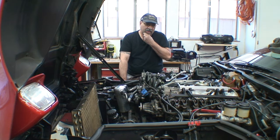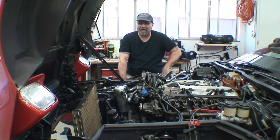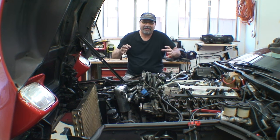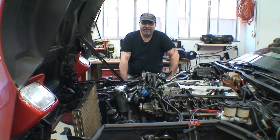All right, fine. So what I ended up doing is an old trick. I never did it, but I've heard about it, and some people were successful, some others weren't. So I filled up the runner with the two dents in it with water, and froze it. When I pulled it back out, it looked like there was some improvement, but not much, because the water expands and the runner tubes are really light. So I did a couple more times. I wasn't getting the results that I wanted.